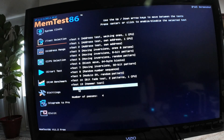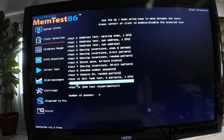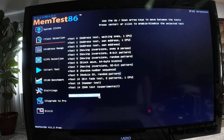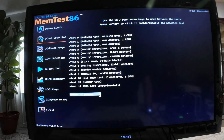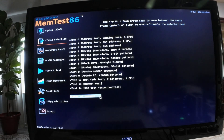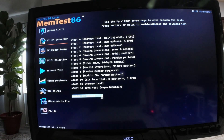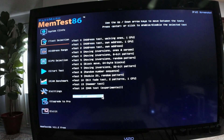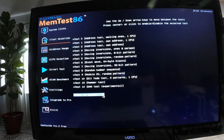The default is tests 0 through 13. Test 14 is not selected — you can select it, and I recommend you do. You also have four passes — four is a little too much for normal testing. If you want you can run all four but it takes about three to four hours. I recommend one pass, and if you have a very persistent problem then run four passes.